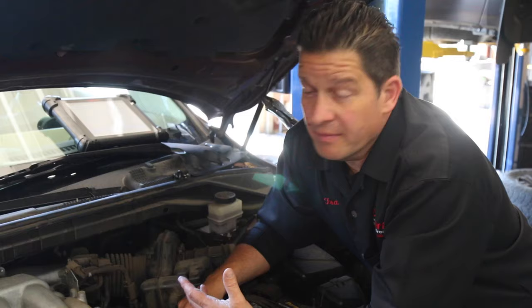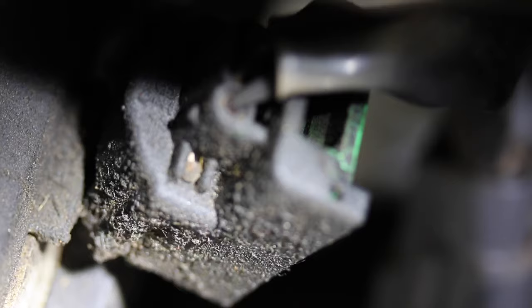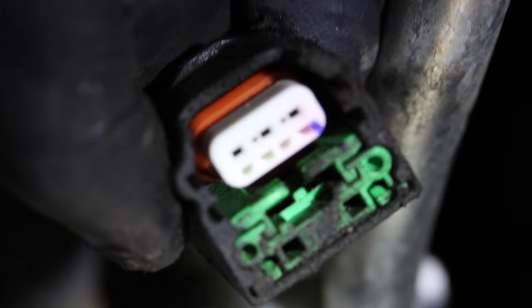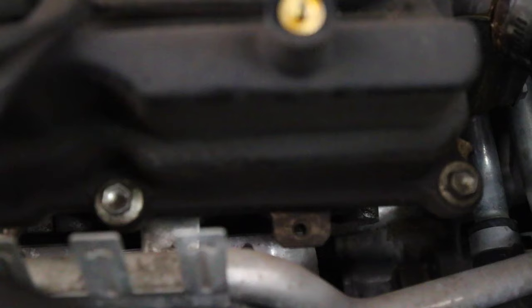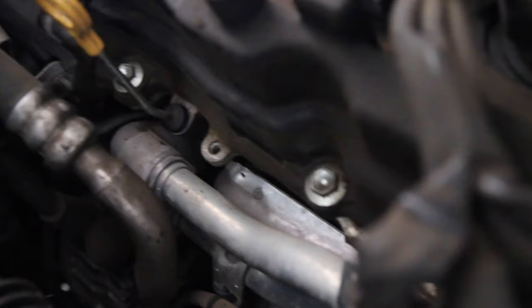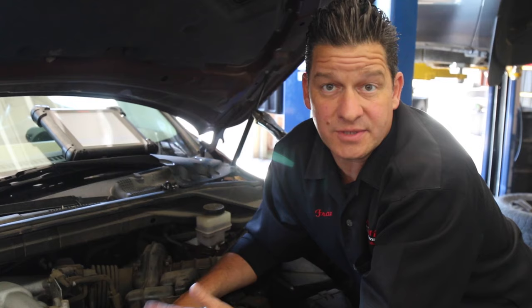The next step after verifying the cam sensor is to check the connectors and test the sensor on the vehicle. Make sure that after you've checked the engine oil level, there's no oil contamination on the actual connectors. Disconnecting this camshaft sensor connector, it's got a little bit of moisture but it's not extreme — we don't have a major oil leak. What can be common is these valve cover gaskets on this 3.5 motor can leak, and if engine oil is leaking onto the sensor connector you're going to lose the signal, which will cause the cam sensor circuit fault. Make sure the connectors are not oily.